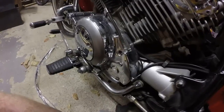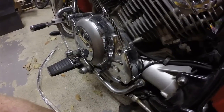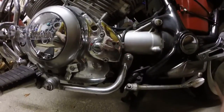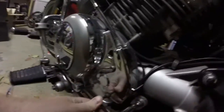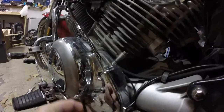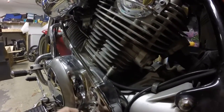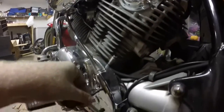I need to follow the clutch cable down into where it connects to the clutch somehow. I haven't opened this up before and the internet is entirely unhelpful on videos, so I'm making one. It looks like it's just two Allens to take this thing apart, but these things were on snug as hell, so I'm kind of curious as to what it's going to look like underneath.